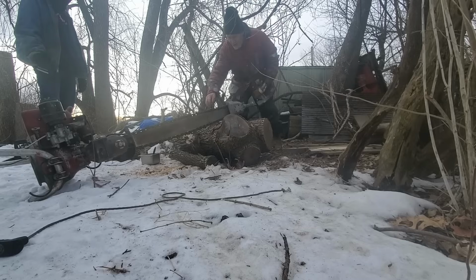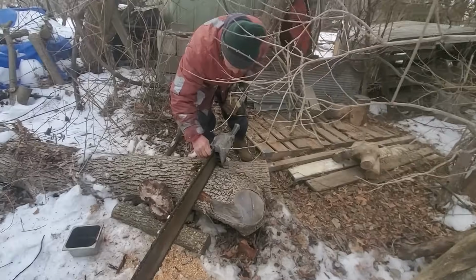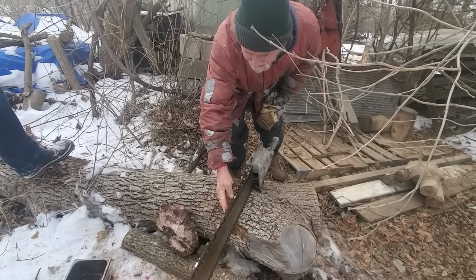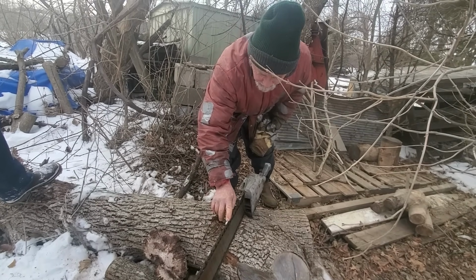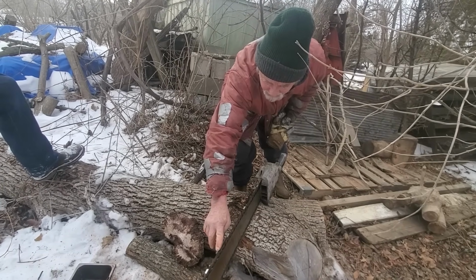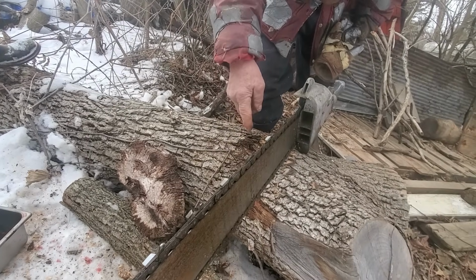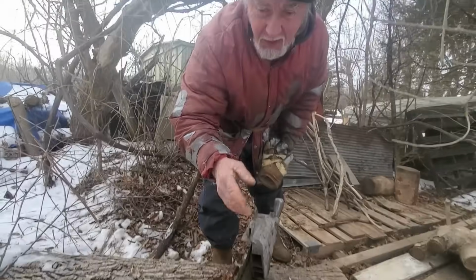I run my finger across the front of it, and there's no sharp edge here at all. Yeah, it's dull. And whoever's been filing this thing has been favoring that side. Look at how much tooth you've got on that one compared to this next one and the next one. So when the guy filed from that side, he was a lot more efficient at cutting metal off, and he didn't file this side to keep them even.